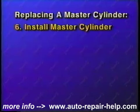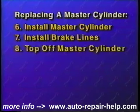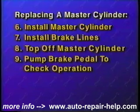Install the new master cylinder on the vehicle. Start the mounting bolts or nuts by hand. Loosely install the brake lines to the master cylinder, purge the air from the lines, then tighten the line fittings. Top off the master cylinder and depress the brake pedal several times to verify correct operation.